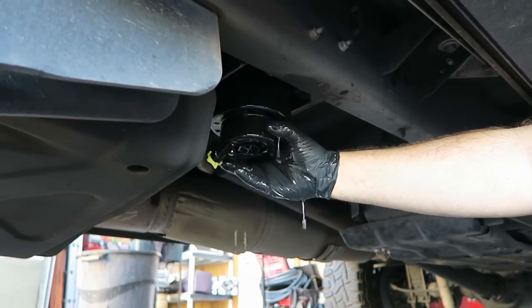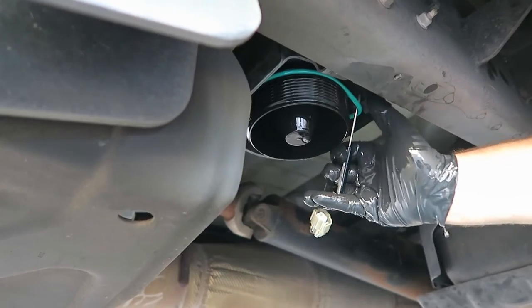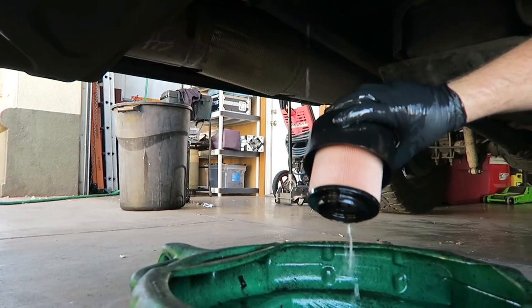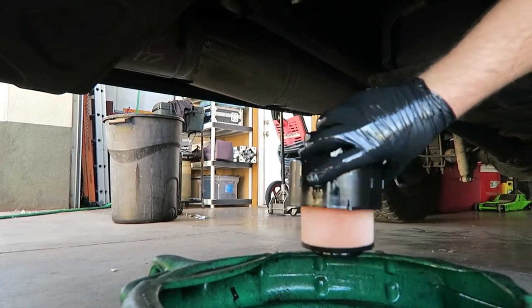You've got to be resourceful if you've broken down on the side of the road. Once you get that filter off, drain out all that fuel. Make sure to replace the O-ring and get it reinstalled. If you don't have access to a parts house for both filters, just make sure those filters are air-dried and cleaned out as best you can.